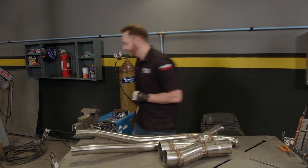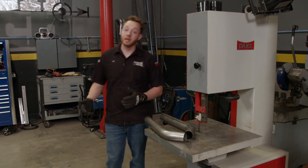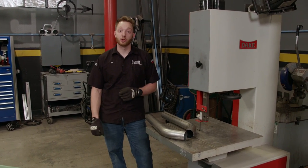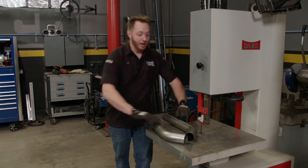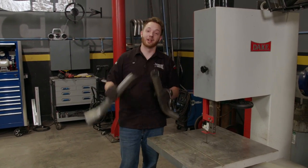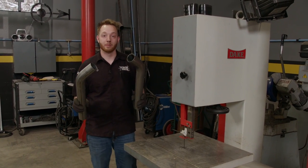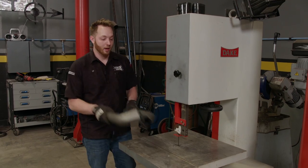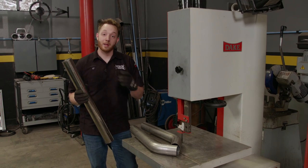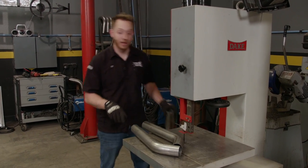We're going to start with a Y pipe. Let's say you have a V6 or maybe even a V8 swapped mini truck. You have two banks of exhaust to deal with, but for space reasons it would be much simpler to run a single pipe. You could just tee the two pipes together, but that's really not the best in terms of performance. So instead I'm going to take these two 45 degree mandrel bends, join them together, and have a single three inch pipe for the remainder of the exhaust. This will be perfect for a mid 350 to 450 horsepower application. We'll get started by making some cuts.